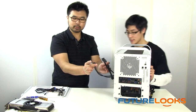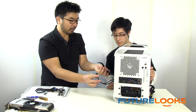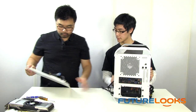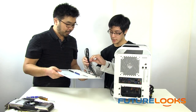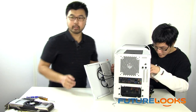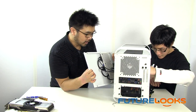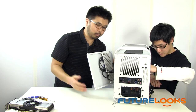We've got our SATA cables through and our power cables through — we actually have three here but only need two, just in case we have a third SSD at the bottom. Let's throw on the side panel and get the front I/O sorted — we've got the audio, the USB 3.0 header, and the power and reset switches. It looks like everything's going to fit, so let's get that going. We've managed to get all the SATA connectors, power and data, to the SSDs, and the cable management is looking pretty good.